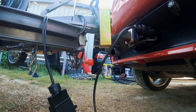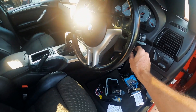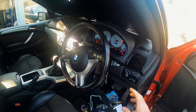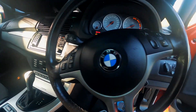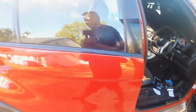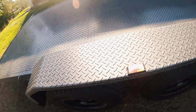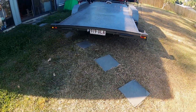That's now connected — let's do some tests. I'm not going to connect the trailer brakes yet because there's a fair bit of current that goes through trailer brakes, so we've got less chance of catching on fire with my dodgy wiring without them. We'll just go headlights and hazard lights. Nothing's blown yet — both hazard lights are working and the taillights. Taillights are on, and we have hazard lights.